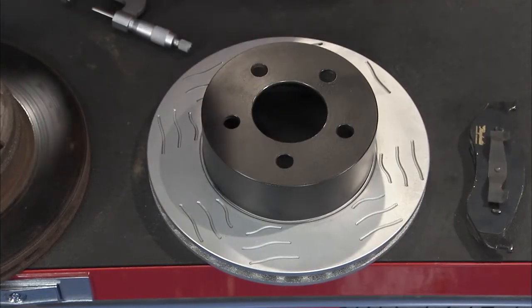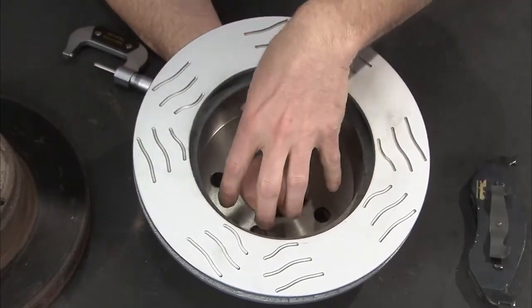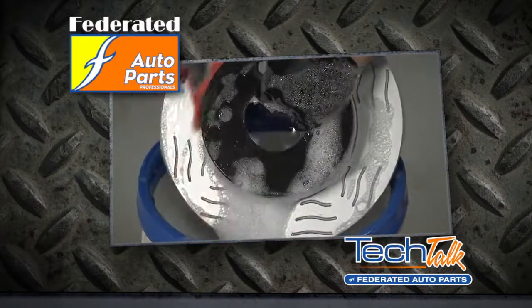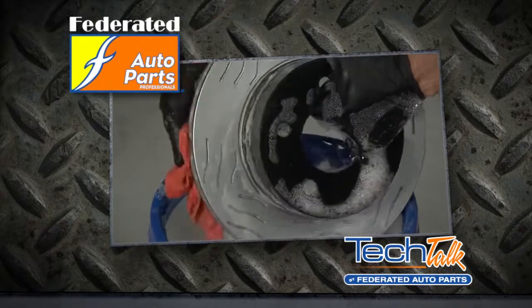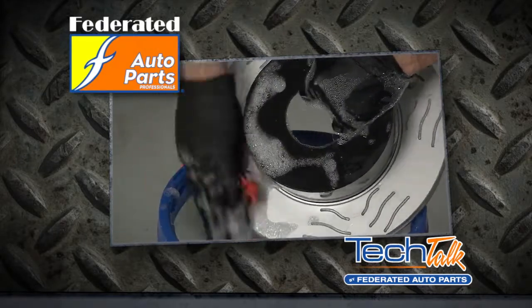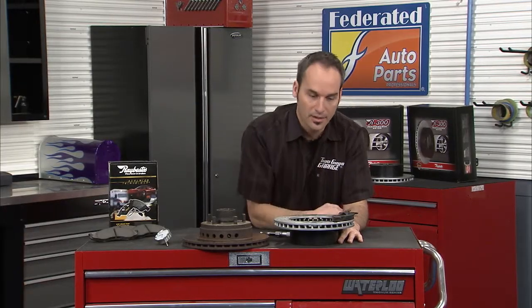You're going to get fade and poor brake feel. These little grooves let the gas escape — they give it a place to go and it's good for NVH. You don't have an abrupt impact from a slot going in a vertical or radial direction. Neat feature. Also make sure you check that there's no dirt or debris between your rotor and your hub — clean that off because it'll cause your rotor to go on a little bit crooked. Wash it with soap and water, not brake cleaner. Everybody's got it at home, it won't leave a residue, and it's the perfect surface for your brand new pad to get you braking down the road.